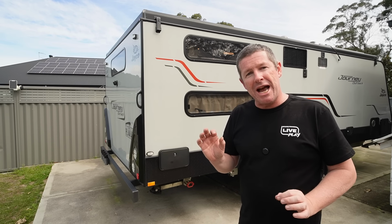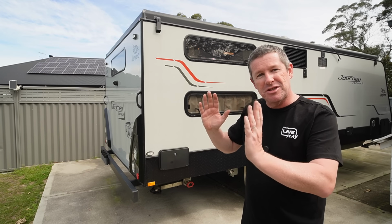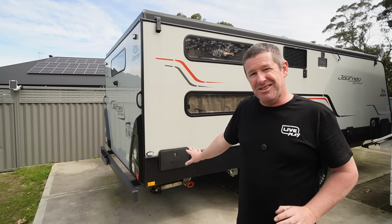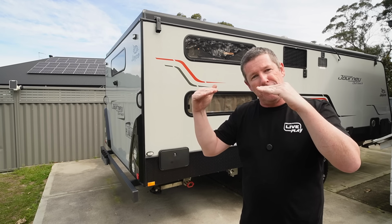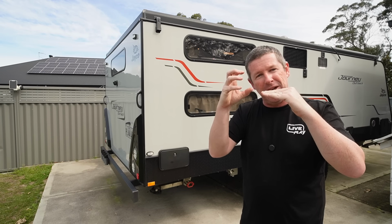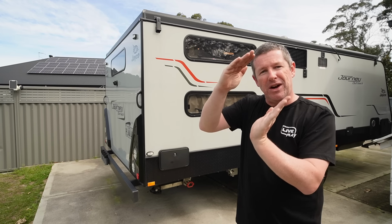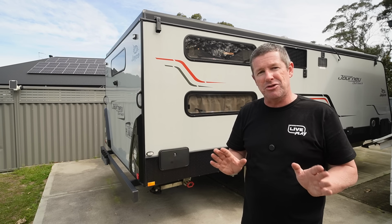The one thing I will change is I think I will mount that fuel filter onto the side structure there, just so I can tilt it a little bit. It's not affecting the operation, but I can see that where it's drawing the fuel out of the filter, it's sitting around about level, so it's not quite filling the top of the filter up. So I think if I just tilt it a little bit, that'll make it that little bit more reliable without too many dramas at all.